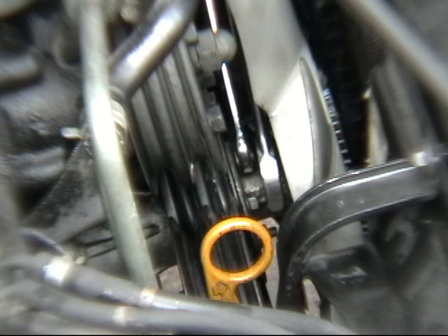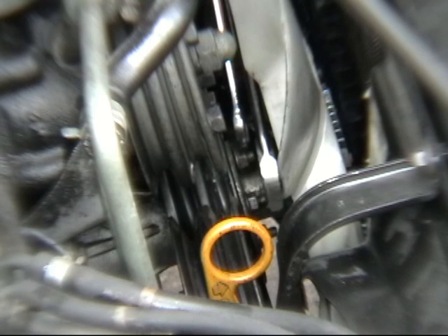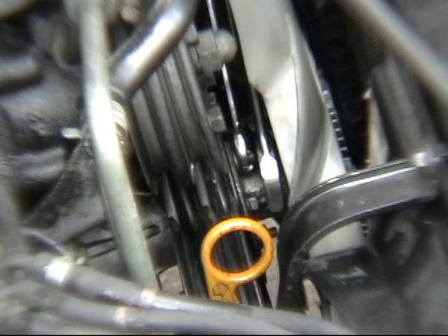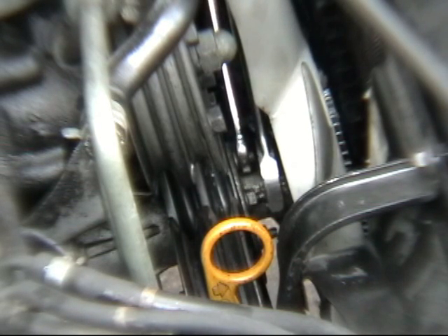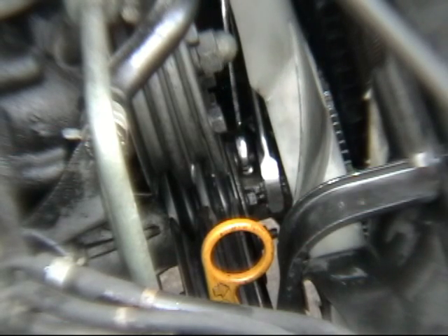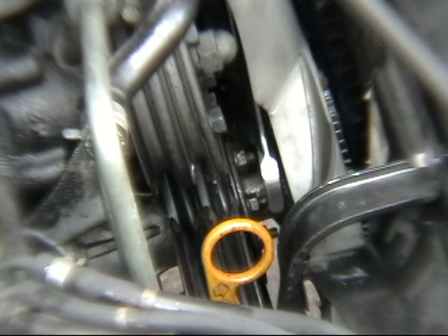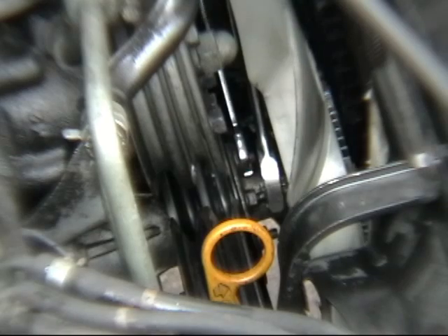The shorter fans commonly found on XTs and turbos I believe are flat all the way around so you can grab onto them from any position. This can be kind of a tedious pain if you are not familiar with it. Usually what it resorts to is threading these nuts on with the tips of your fingers, because you can't really get it on there with both fingers — you almost have to thread the nut on with one finger. But once you get them on there, this is what it takes to tighten them down. And if you have a gear wrench, that is always good too — it saves you a lot of flipping your tool every time you need to get another turn.